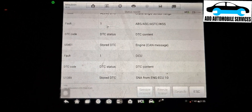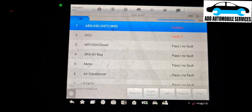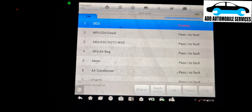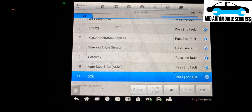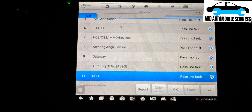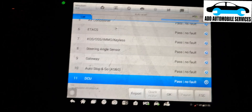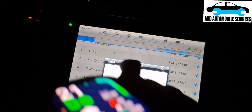What I'll do now is clear it and see. The thing is, when you clear the fault it goes, but normally what happens is when you start it for a while, it clears, and you start it and it warms up — then the problem comes in. The car will be running but the cluster will be down, the RPM will be down, everything will be down, and it will report that same fault code again.